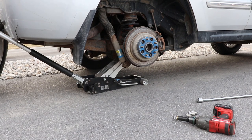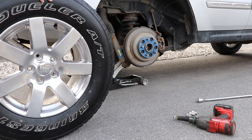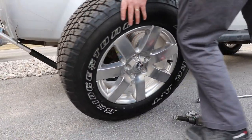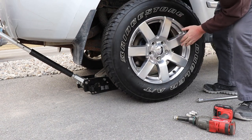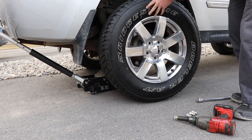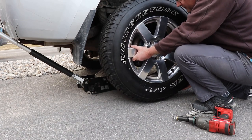The last thing to mention is the tire pressure monitors. On early pre-facelift vehicles — 2005, 2006, maybe 2007 — they will not work with JK TPMS as it's a different frequency. But with 2008 or possibly mid-2008 and newer it should work. If you're buying old wheels, anticipate spending money on the TPMS.